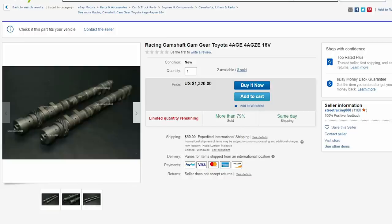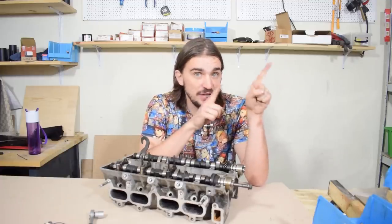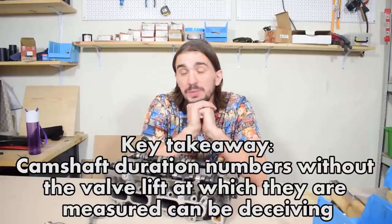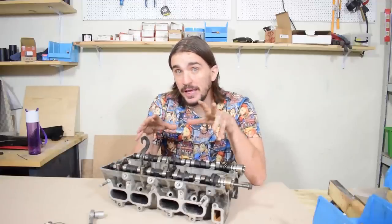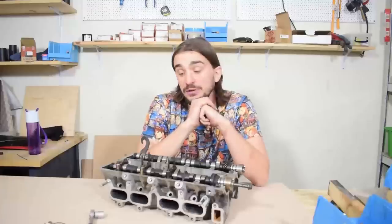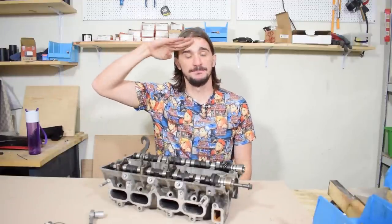This is just one example — there are many camshafts out there that give you duration numbers without the valve lift point. The key takeaway is that advertised camshaft duration numbers, or any duration numbers without the valve lift at which they were measured, can be pretty misleading. So the next time you want to buy cams from someone on a Facebook group, make sure to ask about the valve lift point at which duration was measured, because that's the only way to properly compare different camshaft options for the same engine. I hope you found this useful and informative, and helpful for your future camshaft upgrades. Thanks for watching, and I'll see you soon with more fun and useful stuff on the D4A Engine Bootcamp.